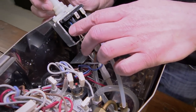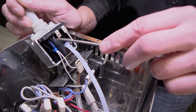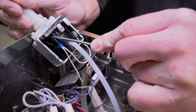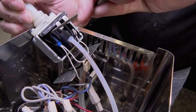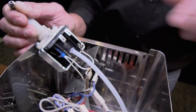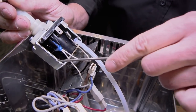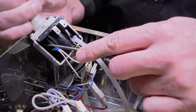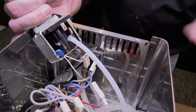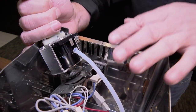Now we have this thermal fuse — if the pump ever overheats, this will trip and shut the power off to the pump. In order to get it out, I usually just take my little pick here and go up as far as I can behind the fuse in the opening and pry it down so it starts coming out, and then I can pull it out the rest of the way. Sometimes they pop right out; sometimes they're a pain because they use hot glue around the bottom of it. Once you get it to slide out, it comes right out. Then set those two wires off to the side — they're the only wires we're going to disconnect.